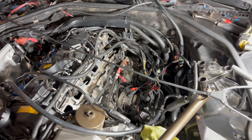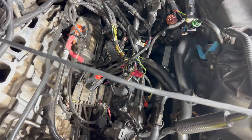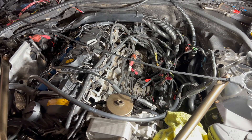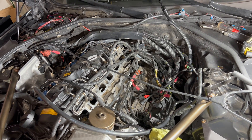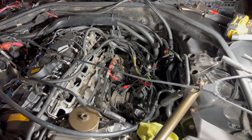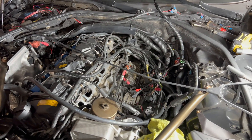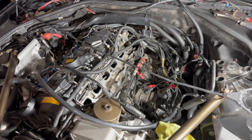You'll notice on my DME connections you can see some of those little T-spade connectors — those are tapping into the lines I needed for the Reflex Plus. I'm not a huge fan of those T-spade connectors because from time to time I'm struggling a little bit with the connection. I might have to look at doing something different there, since they do typically come with Posi-Taps, or you could replace the entire wiring harness — they actually have a BMW harness available. My Reflex Plus as well as the intake manifold I was able to find for a good deal on Facebook Marketplace, and that's the reason I was able to make this jump to port injection sooner than I thought I'd be able to.